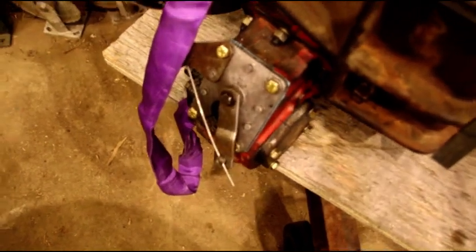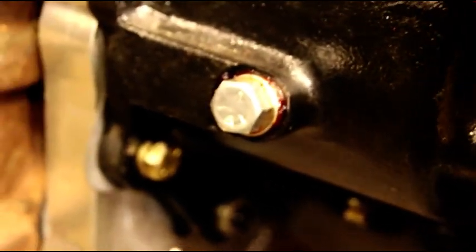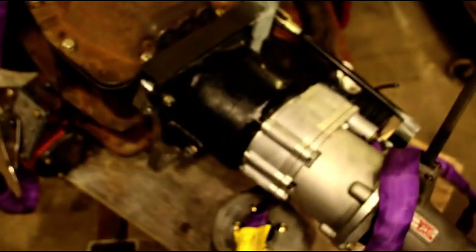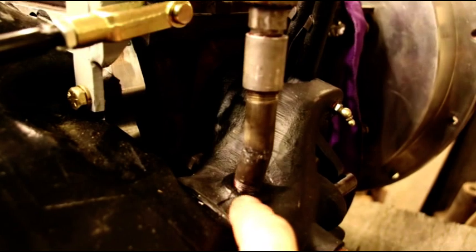We've got our shifter there and PTO shifter, so it took quite a bit of lube to fill that up. This is a big-hole case — the transfer case on the big-hole cases. This is where your pivot for your clutch linkage would go — on big-hole cases that's hollow right into the case. With it clocked so much, this becomes my lubricant level indicator right here. When you clock it to the third position I fill it through here, so there's a lot of lubricant in that transfer case because it's on such an angle. When you fill it that high, here's your vent — your vent is usually down here. When you fill it properly to the right level, the lubricant is just a hair under your vent.